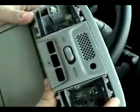The rest of the installation is fairly easy, as all you're doing is reversing what you did earlier. Reattach your wiring harnesses, making sure they are secure. Put the entire module back up into the roof line and attach the four bolts you removed earlier. Once the console is secure, replace the two lens covers and make sure they both light.